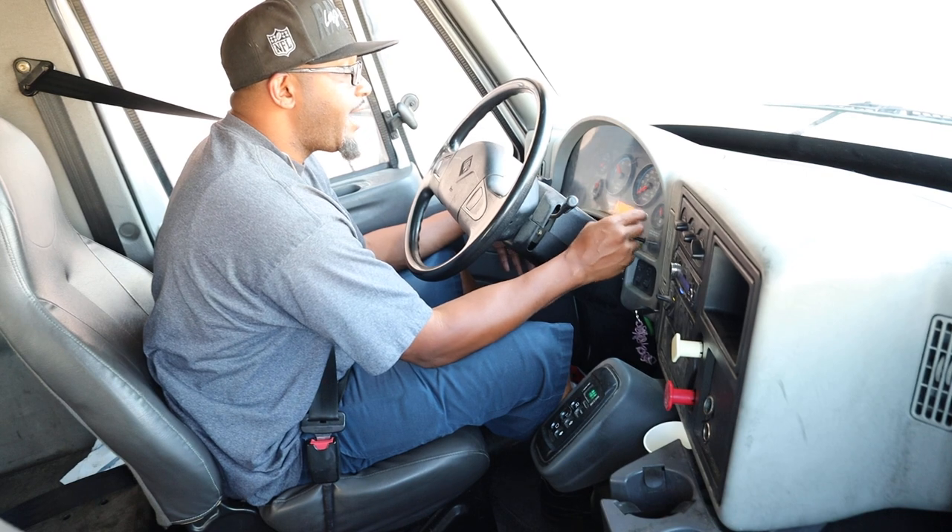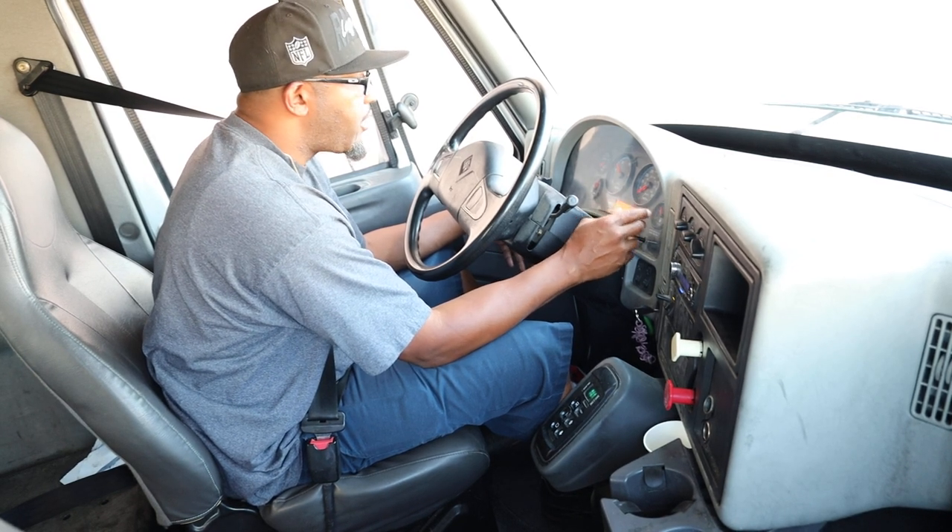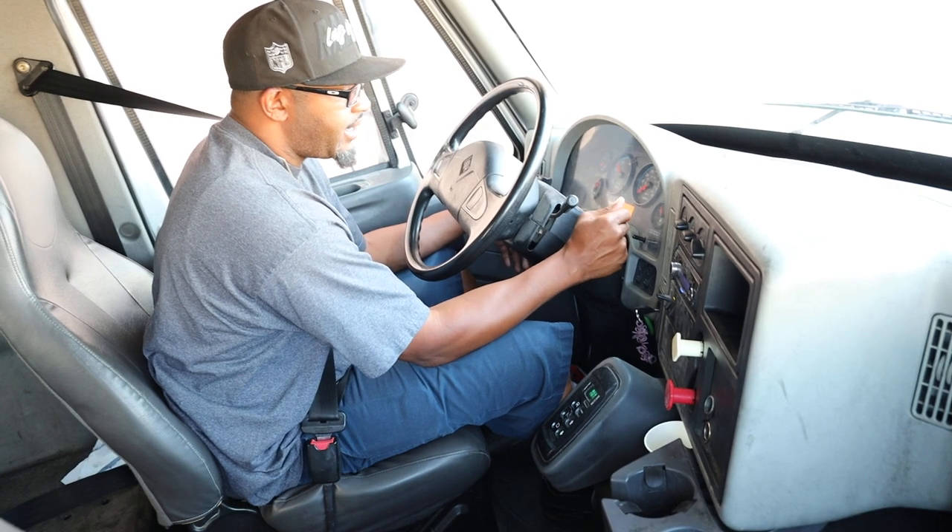My primary and secondary air should be between 110 and 120, never over 130. It's at 100 and rising right now.